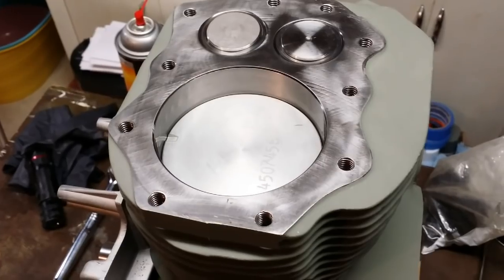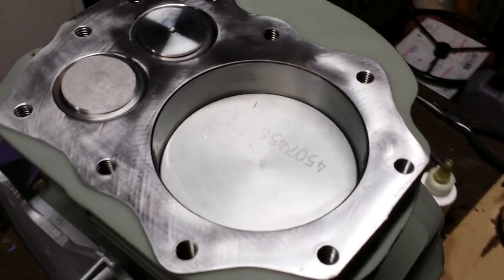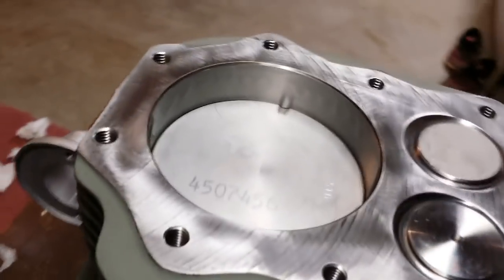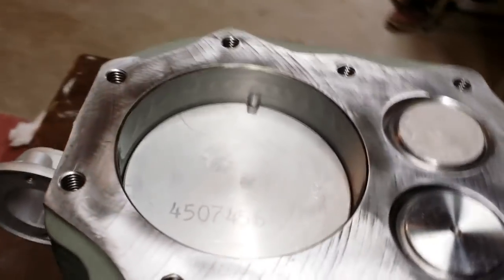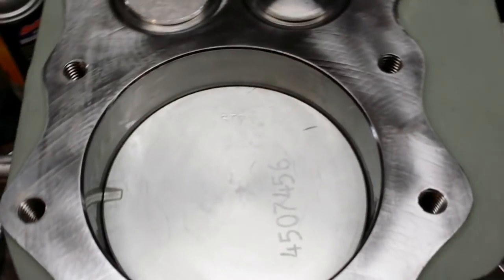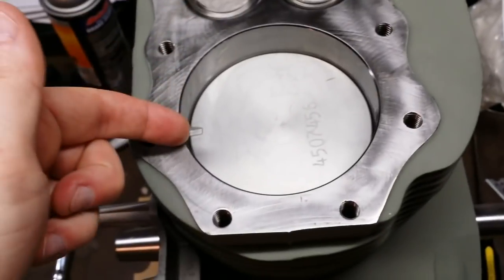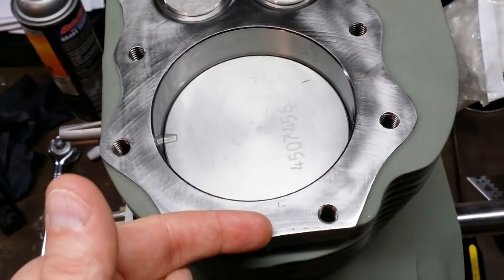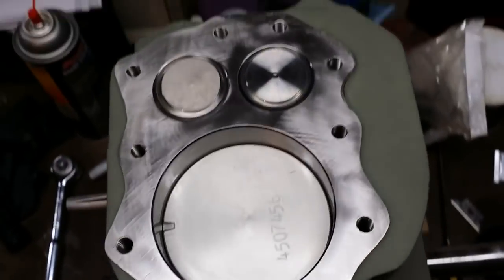Here's the top-side view of the install. Looking around the bore itself, there are no scratches and no dings, which tells me the rings went in nice and smooth without any issue. The chamfer is nice and clean — none of the rings clipped the edge on the way in. We have the notch toward the flywheel and the oil hole on the rod cap pointing toward the camshaft, so this install is done.